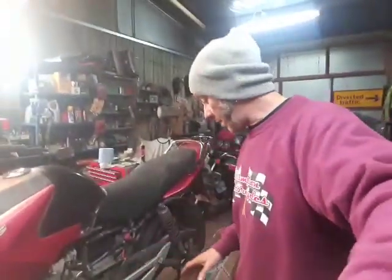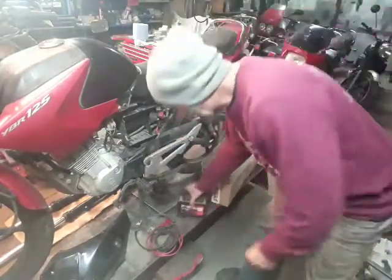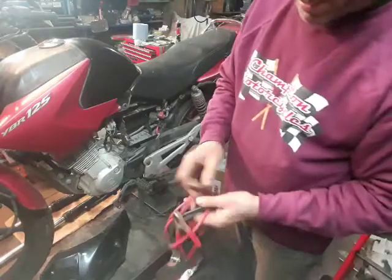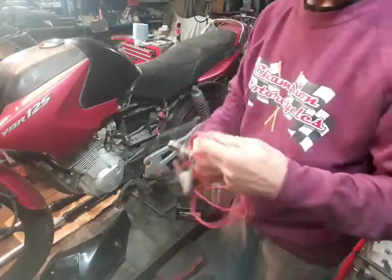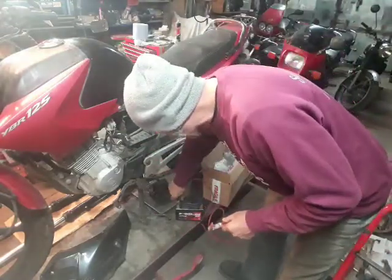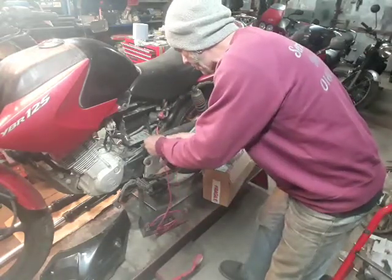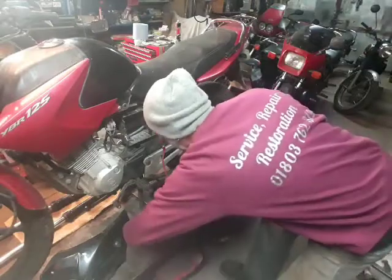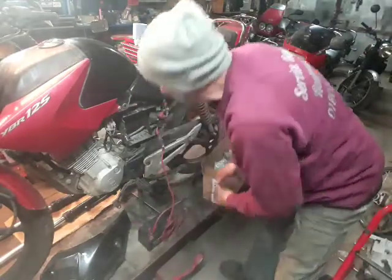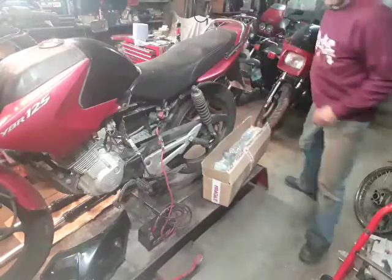Battery was completely flat with this, so if you look down here, I have my spare battery and a couple of jump leads. Lightweight jump leads, you only need lightweight jump leads for the bike, so we can put that on there. Make sure it's not going to earth out onto the frame because you're going to get sparks, obviously. Put that one onto the earth lead. Then I'll put my pliers in my pocket.